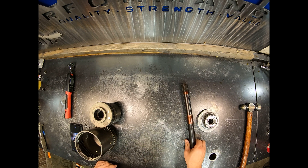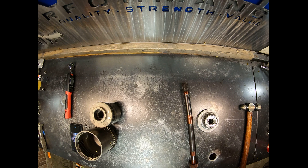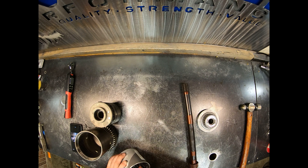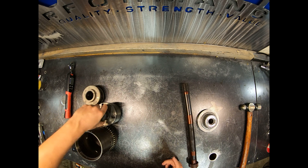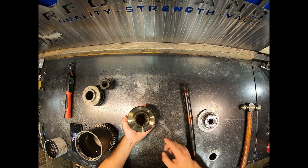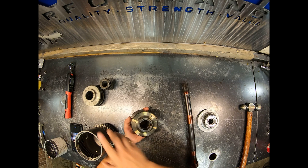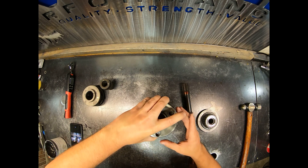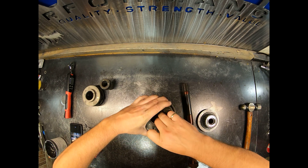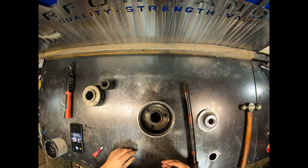So let's go ahead and put this together. One thing you want to do is keep a little grease on hand — or just a little bit of transmission fluid will work too. You're going to want to grease the areas that come into contact with things, like the bottom of this VCU here. You just don't want a dry start. This will actually turn inside there and you don't want it turning dry. It will drop into place and you can rotate it easily — you can see that's all lubricated.